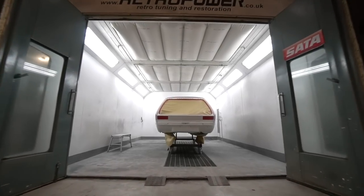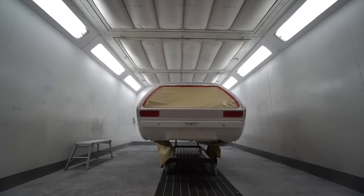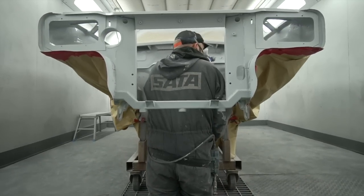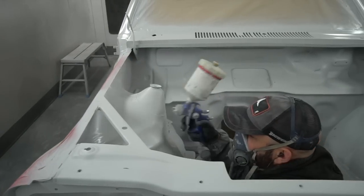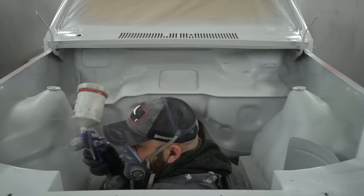And I don't know whether they're working on the Chevette right now, but we got to a bit of a landmark point with the Chevette. We finally got to the end of all of that polyester block sanding and got epoxy on, and it's that kind of rapid snowball effect from there on. It feels like you've been climbing a huge mountain and then you just slide down the other side.